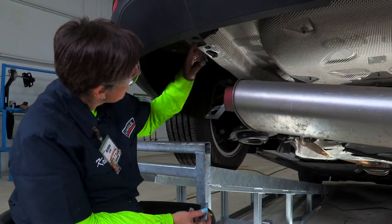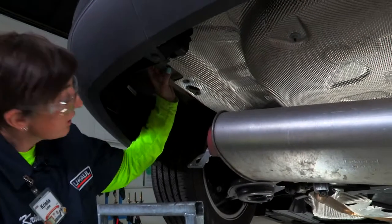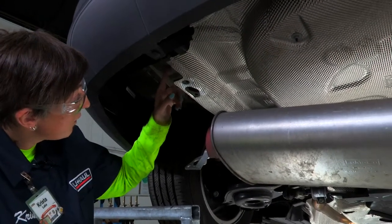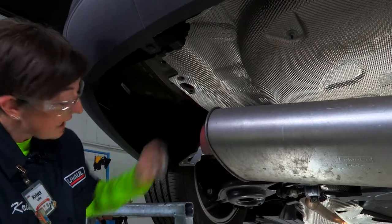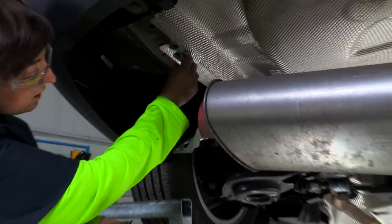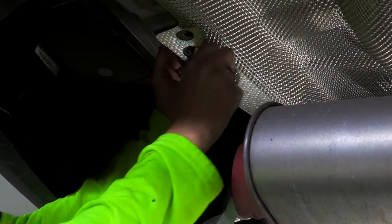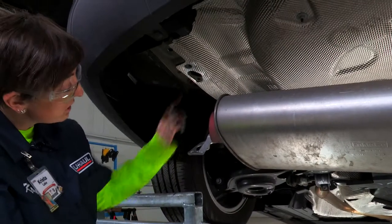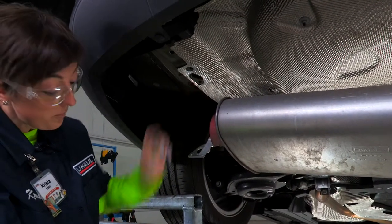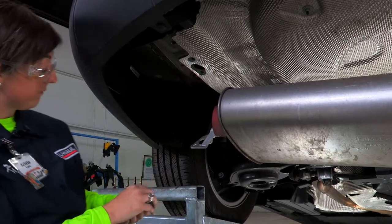So, to get this carriage bolt and carriage spacer to the foremost hole that we drilled, I'm gonna need to use this access space. If you'll notice though, our carriage spacer goes in nice and smooth, but our carriage bolt misses by just a hair. So what I'm gonna do is use an air saw and we're just gonna open this up a little bit to allow the bolt to go through so we can fish wire it down.